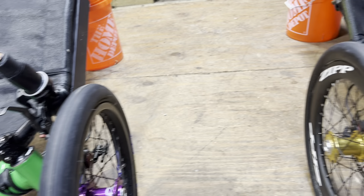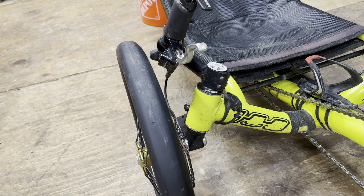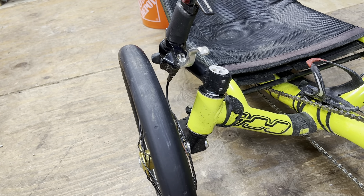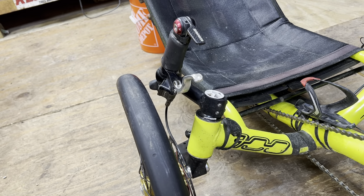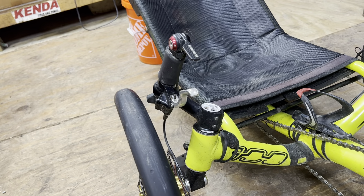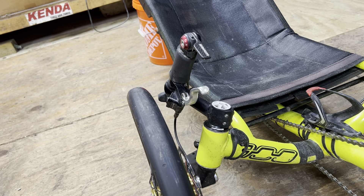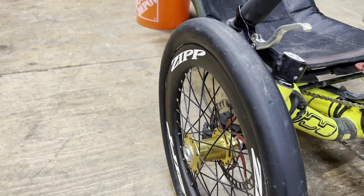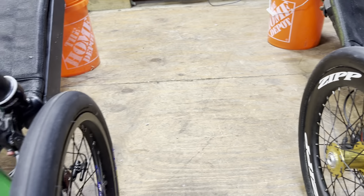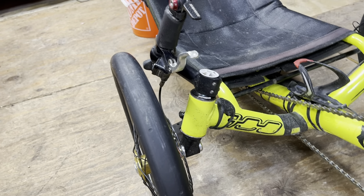Also on a hydraulic, which we have over here, the pads are self-adjusting. I'm getting four to six years typically out of the pad life on the Hopes — for me that means about 30 to 40,000 miles. I use the metallic pad, so they're working really well, last a long time, very strong, and I have no issues with brake drag or anything.